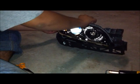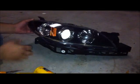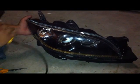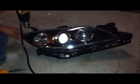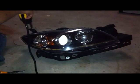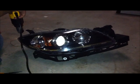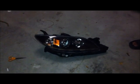Now that you're done with your LED strips, you can put this back together now. After you have reassembled the housing with the wire out, do your best to reseal the housing. The way to reseal it is you just run this back and forth after you've reinserted the whole housing back into place. It should melt the glue back in the spots. After you've completed the housing, make sure you just let it dry for about 5 to 10 minutes, and then we can get onto the wiring aspect.